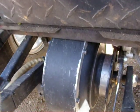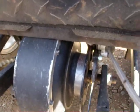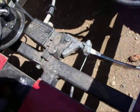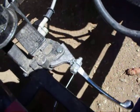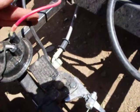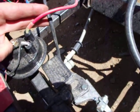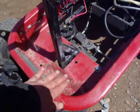You zip-cut the rim off. There's the motor with the hydraulic brake still on there. The hydraulic brake cable goes to the old handle — he put the cable on, hooked it to the brake pedal, and sure enough it pulls the lever. He still left the electronics on it, the switching, so it still operates the regenerative braking and all of that stuff. That worked out pretty well — good way to do that.